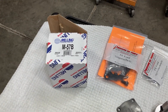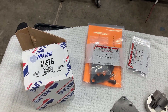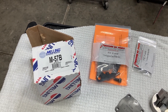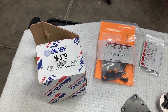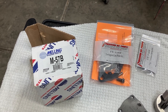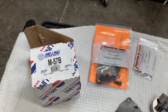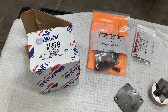This engine is going to be turning some RPM. To be honest, I've never built a tunnel port this small. I know it has a lot of cylinder head and a lot of camshaft, and it should want to spin up — especially with the much lighter flat plane crankshaft and the lighter aluminum rods. It should be very responsive to RPM.